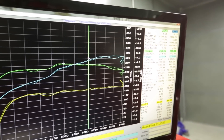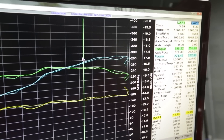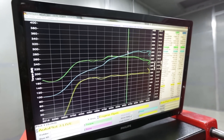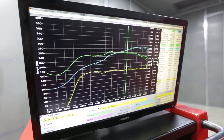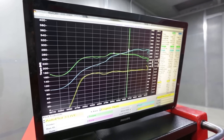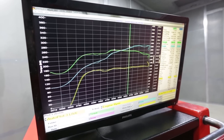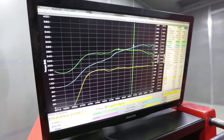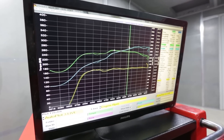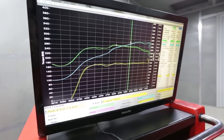On the bright side, we've played with the knock control on the EMS, and you can see that little dip — it's picking up the knock and reducing timing, which therefore reduces power. The conundrum we're facing is we can't make any more power because of the knock. We've been thinking maybe it's injectors or bad gas. The gas is probably about 6 months old, but I put in half a fresh tank of 94 octane, so that really shouldn't be affecting it that much. Our next plan of attack is to run the meth injection at all times, because neither Sasha nor I are confident this setup will be good for the racetrack if it's knocking at such a low power level. The meth injection will make sure we don't have issues.